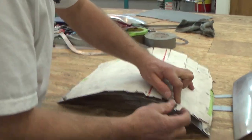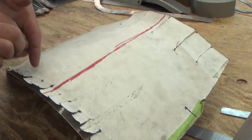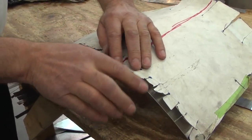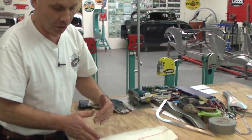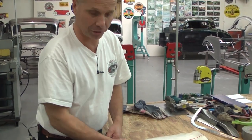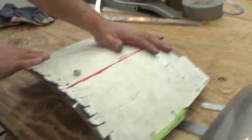Check here. So this edge — we haven't stretched it too much. Sometimes the flange, this edge, can be a little too far down. So when we wheeled it, we stretched it too much. If that happened, we need to go in there and trim this or grind this off. But I've checked this one now and I see that this one hasn't changed anything.